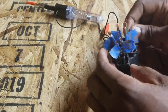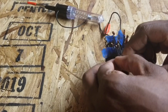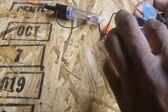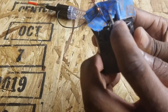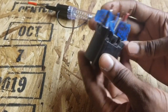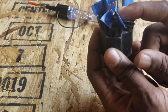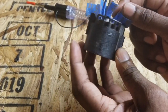So the park lamp is like a reddish-brown wire, and that's for the park lamp. The center wire — it doesn't even matter what that's for right now, because it's the only one left in the center. It's the easiest wire to figure out — that white stripe wire goes in the center. So let's hook this up.